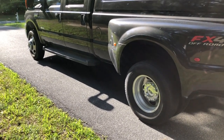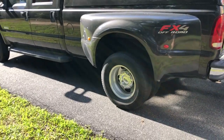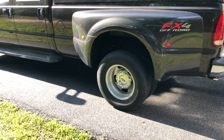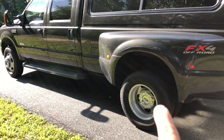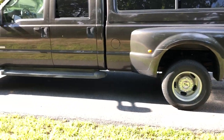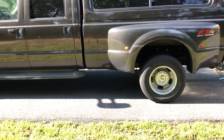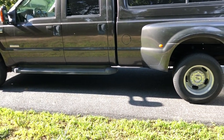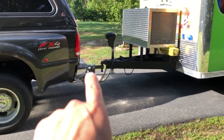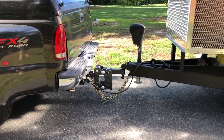Raising up the front leads to issues with losing steering, or your steering kind of vibrating, because you're lifting the front end as you're driving down the road and hitting bumps. To mitigate that, you want to install airbags. In my vehicle I do have airbags and I've lifted it to about 60 PSI in the rear to bring it up to level. I usually ride around 50 to 65, gone up to 70 testing, and the sweet spot for me is about 60 for this truck and trailer — though with the extension I'll have to make adjustments.